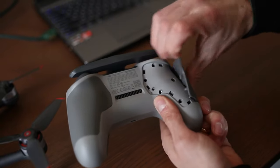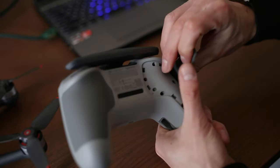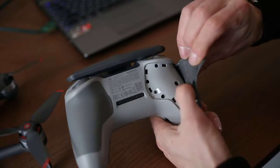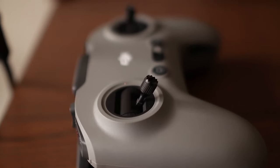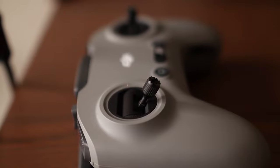To adjust that setting, you pull back the plastic cover on the back of the remote and turn the screws all the way to the right. This will loosen up the resistance and cause the left stick to stay in place instead of going back to center.